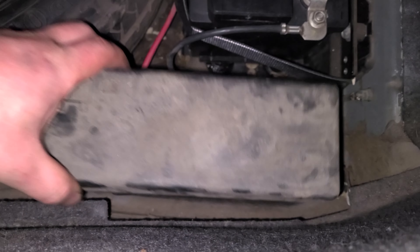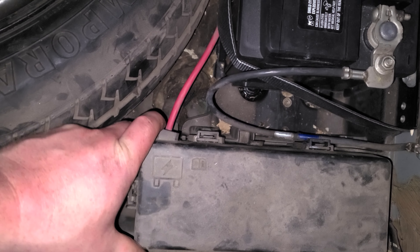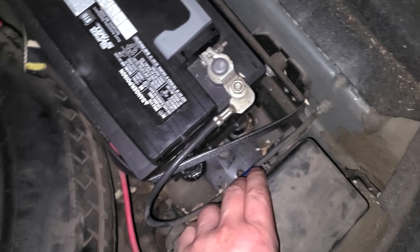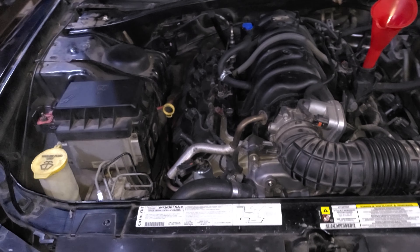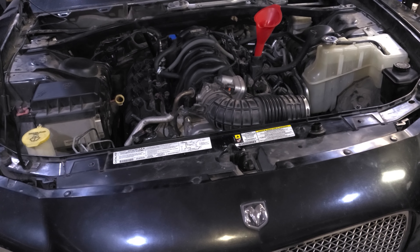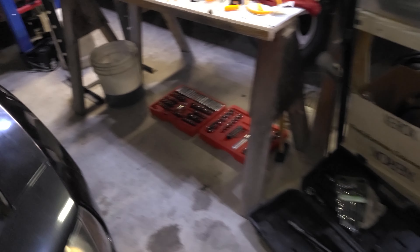This is actually a really good angle to see what we're up against here. The engine mount up here is connected by two bolts inside around studs here and here. We're going to take off the OEM stuff and show you the new stuff and how it differs. Turns out the motor mount itself doesn't have anything wrong with it, but the bolts that hold it to the frame mount are really loose — this has not been tightened yet. You can see it's just free floating there.